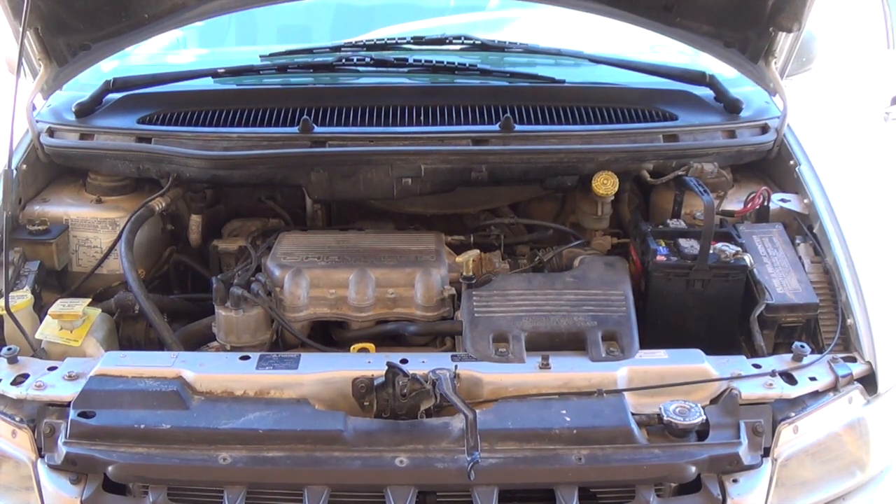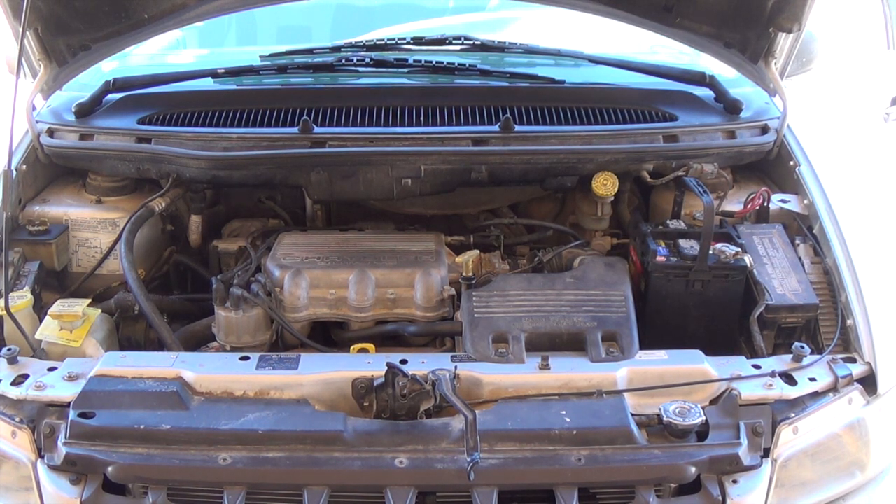Alright, she's done. I'm going to start her up. She's done — I started her up and she's running pretty good. Quick rundown: I changed the filter and I cleaned out the throttle body and the air intake control valve. Now I could have pulled the whole thing apart and cleaned it out a little better, but that would have required me to get some extra parts. This is a quick way to fix my idle problem. My name is Wolverine McStud and thanks for watching.